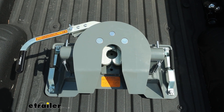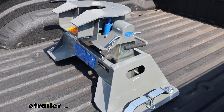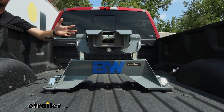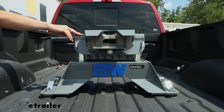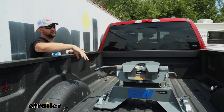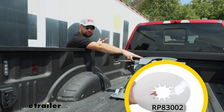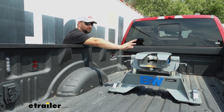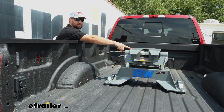Right off the bat, you're going to notice how well built this hitch is. B&W stuff is very, very thick, sturdy steel construction. The powder coat on here is almost like no other powder coat out there. When it comes to fifth wheels and accessories like that, their powder coat is super thick and it's going to last for years to come, even with your fifth wheel out in the bed of your truck. We do recommend using a lube plate or grease to go with your fifth wheel. I personally like lube plates more because you don't have grease everywhere. We recommend using that because if you don't, you are going to get quite a bit of friction and that will take the paint off.